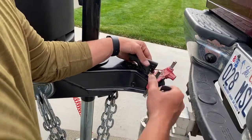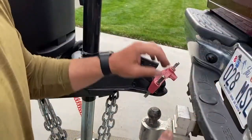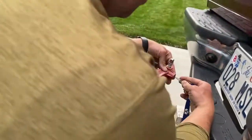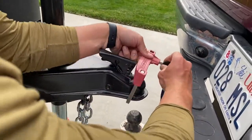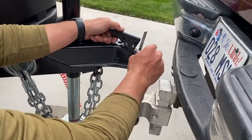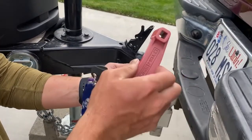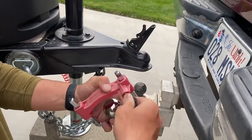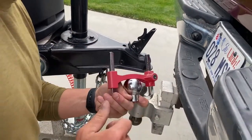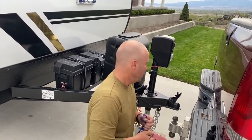Get the black key. You're going to get a lanyard — you have a purple one which is to the door, and black which is to the trailer lock. These are also to the compartment cubbies in the front of the trailer exterior where you store your storage bins. Get the black key, but first remove the pin. Put in the key, turn it, pop it off. It's not going to come off yet because the trailer latch is still holding it in. So lift it up — trailer ball comes out. Then just slide it back on and store it. Anytime you're disconnecting from your trailer or leaving for the day, you'll put it back on. Just remember, it's held on by that trailer latch.